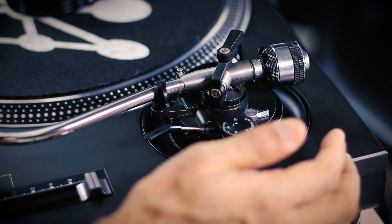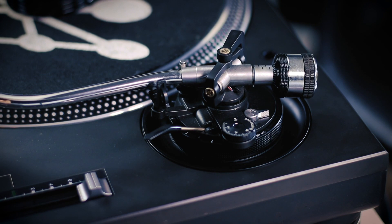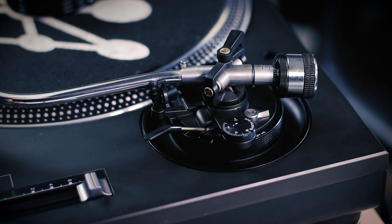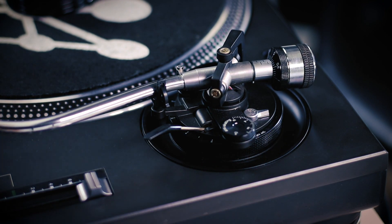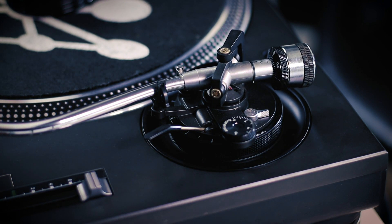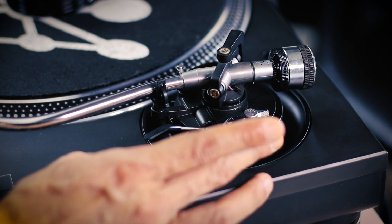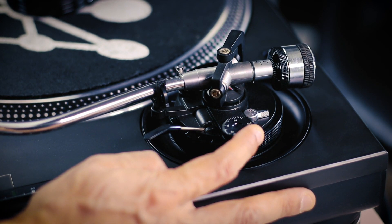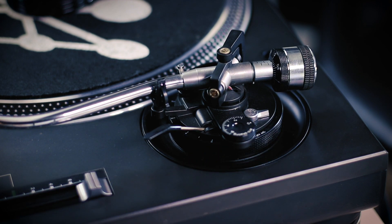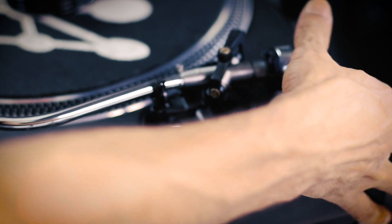We should set the anti-skating amount. So we'll go back to balance and we'll see how it goes forward and back. That's at zero. If we set it to six, the anti-skating will push the needle all the way back — we don't want that. That's too much force on one side of the record groove. And at zero it's too little force, it's pushing it forward. I find for myself, two is good for scratching and DJing. Now once that's done, we could set it to three grams.